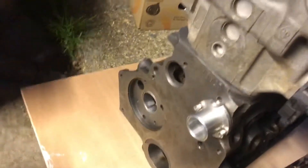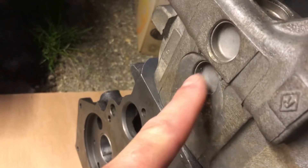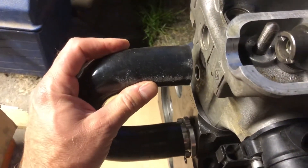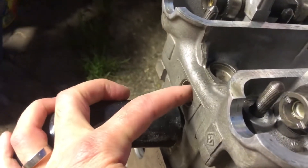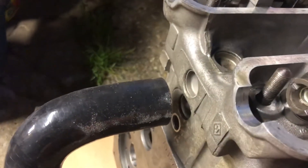The BMW head on the Mini block — the water section on the head is here. First things to get modified: punch that out, get the whole end of the head welded up, and then get this water outlet fitted onto the end of the head so that this pipe would sit like so. There are many ways to do the breathers; I'm favoring a little outlet coming off here as a breather on this end, and I'm going to use the Force Racing conversion plates.